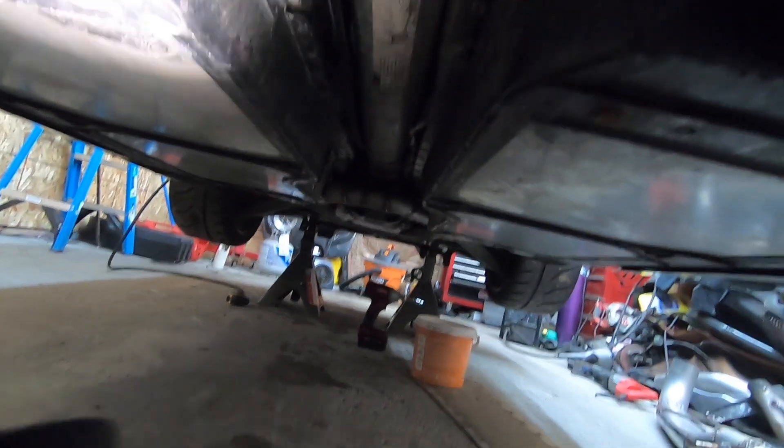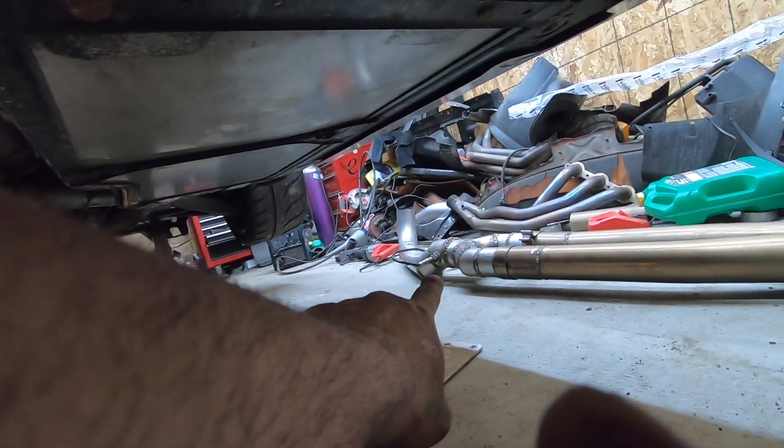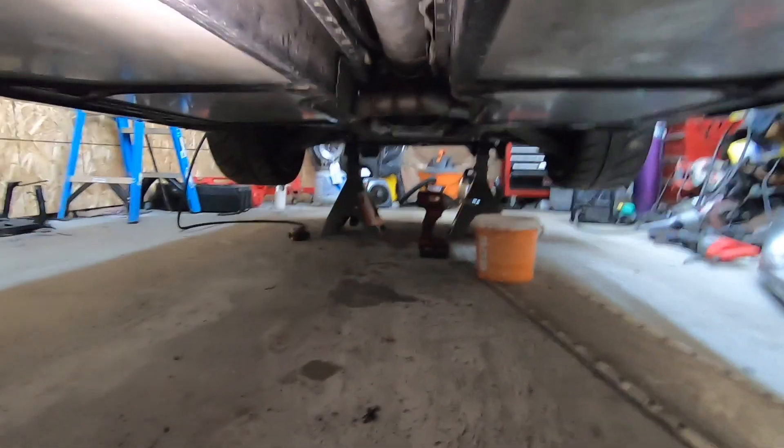Alright guys, I was running into trouble with the exhaust in there — the line was getting caught up on the center section where the bolts go through. So I ended up removing the plate and removing the exhaust. I actually cut it because I ordered a 3.5-inch V-band just to keep this thing serviceable. The way the exhaust was, everything fit perfectly but I couldn't remove the downpipe and separate it from going to the X-pipe. Doing that makes it super simple to pull everything out. I also want to see if I can suck that exhaust up another half inch because there was still a quarter-to-half-inch gap in there. It shouldn't vibrate because I'm going to heat wrap the whole downpipe and everything across.